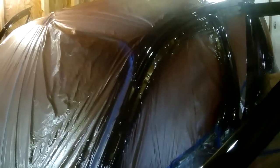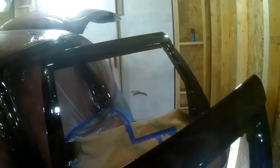Okay, well this is the second coat drying, and I do need to put a third coat. In fact, when I do the outside of the car, I believe I'll be putting four coats of each color, just based on the coverage I've seen here in the jams. I did only put two coats of the red, but I was going over red, and in the few places where I had to spot some epoxy in, you can actually see that if I shine a light on it. So on the outside that wouldn't be acceptable. In the jams it's okay.